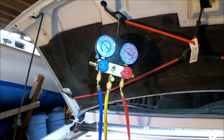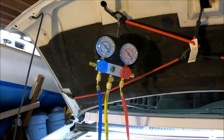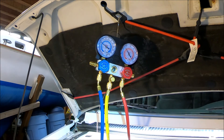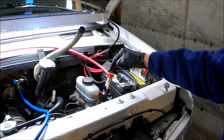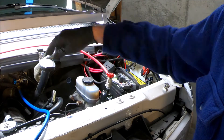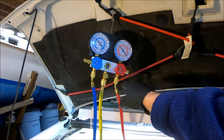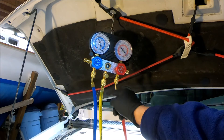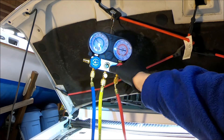At this point I've got the system charged up. I've converted it from R12 to 134A — got about three and a half 12-ounce cans of 134A in there. I've had it running for a little while. I'm going to go ahead and purge the line, take this can off, and close this valve here on the high side. So now this hose is isolated from the AC system. I'll open up the high side and all the refrigerant from here will go into here — just a little bit.